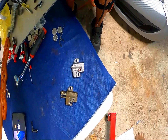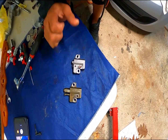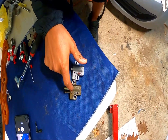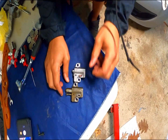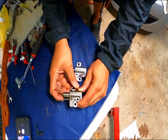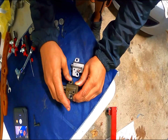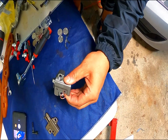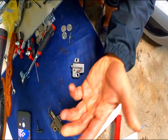I had to step away for a few minutes because I was trying to find this timing chain tensioner right here. I wanted to give you guys a comparison. You're not supposed to reuse the timing chain tensioner — you should always buy a new one. The reason being is because this little piston here you can push in by hand, but this guide right here you cannot get back in once used. These are meant to only be used one time. When you get the new one, you're going to see this little pin — it's kind of like a grenade — do not pull it until you install it, or else you're going to need to get a new one.